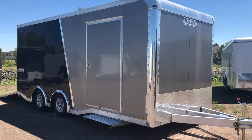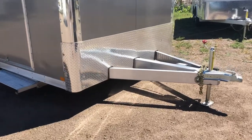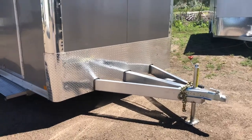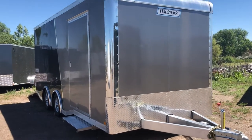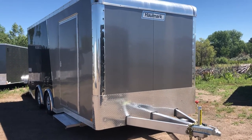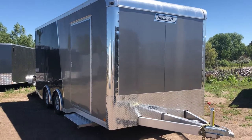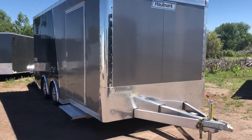You've got the polished aluminum strip in between, and the trailer has a lot of really nice features. It's on a heavy-duty 6-inch frame with a nice big extended triple tube tongue — this is at least a 4-foot tongue — which gives you a much better turning radius when pushing the trailer back. It's an amazing trailer to tow behind a Class A motorhome because it's super lightweight being all aluminum. It'll save you about a thousand to fifteen hundred pounds over a standard steel 8.5 by 20.